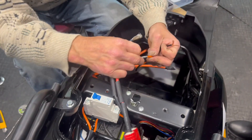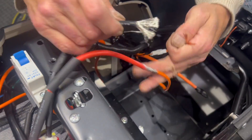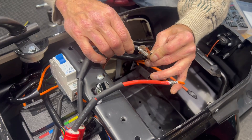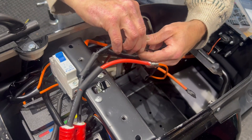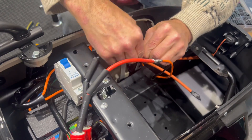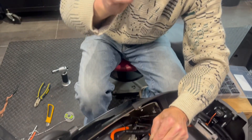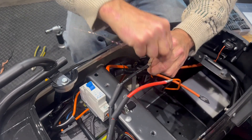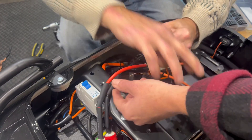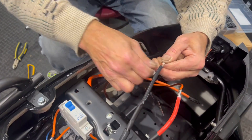It's really hard to get those together to get a nice connection that a piece of shrink tube will go over. So if you can solder, just put those together, split them into a Y, twist them so they're a nice barrel shape. Then if you got a little piece of speaker wire or whatever, take a couple of strands out and just wrap it really tight. This is what I call my Eastern Union splice — any sparkies out there will get that one.